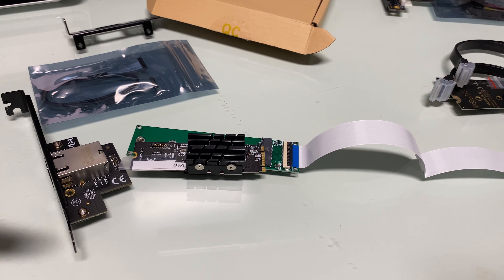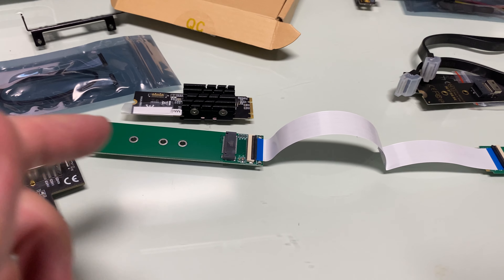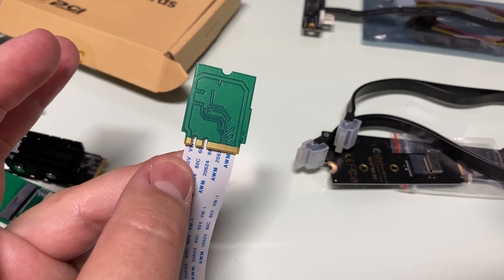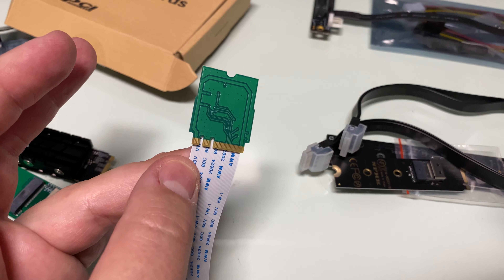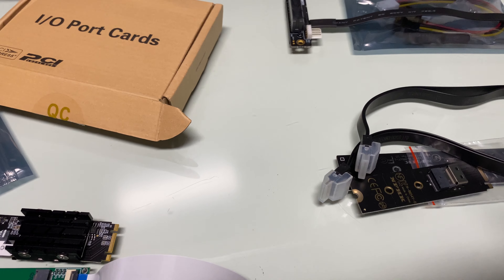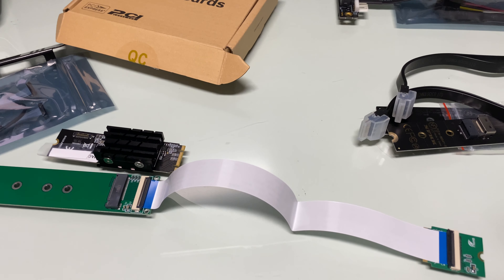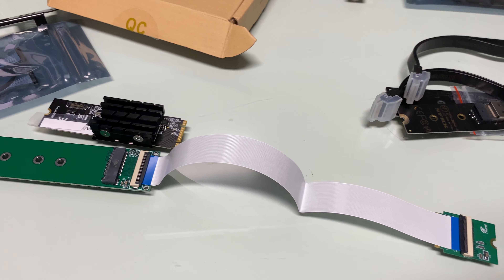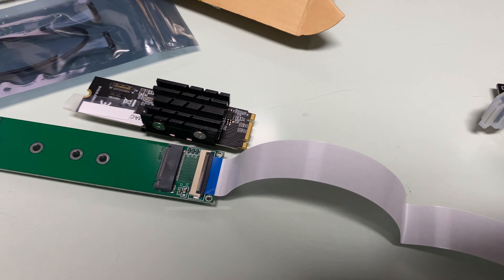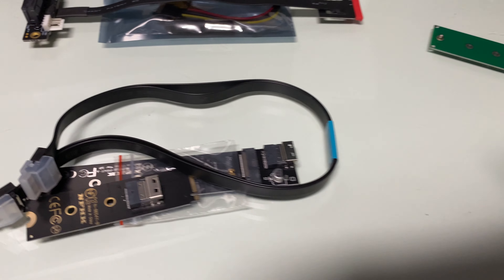With the long extension cable, you plug this into the Wi-Fi slot and everything stays outside the laptop — the wiring and the chunky heatsink have a place to live and dissipate heat. A lot of laptops have only one NVMe port already used by the OS, so you can't easily get 10 Gigabit networking unless you use Thunderbolt, but I've been having so many issues with USB4/Thunderbolt that most people just use USB 5 Gigabit cards.